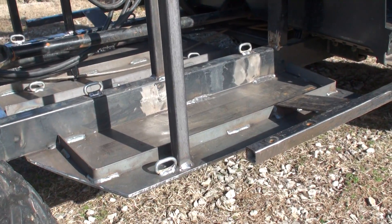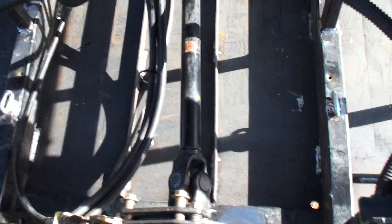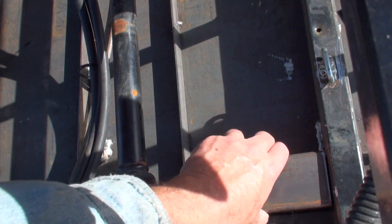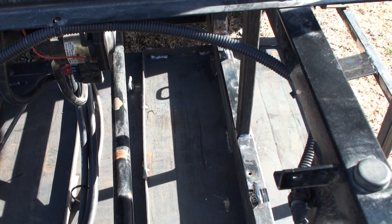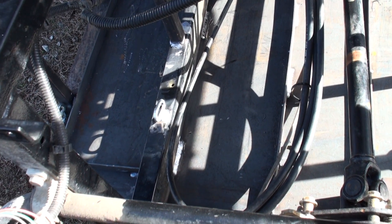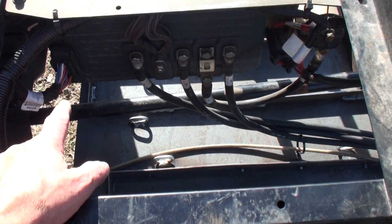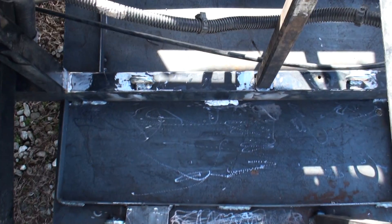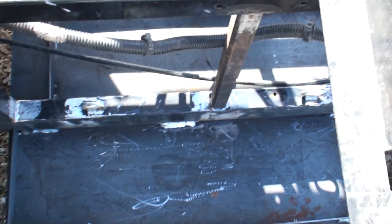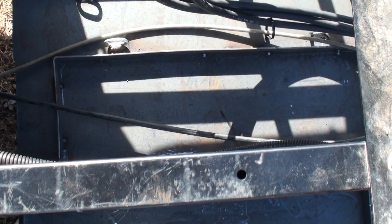The batteries are in slightly different positions from one side to the other. Basically it's this one here — the two in the middle. I've got the little spacers, and it keeps the batteries farther forward. This set has to go farther forward, this set over here has to go farther back. This one has to go forward because of the clearance on the drive shaft, which we talked about earlier. This one has to go back mainly so we don't have to worry about these electrical connections here and here — those have to go back slightly. The ones on the outside are in the same position, and really it's only this one that has to go farther back.